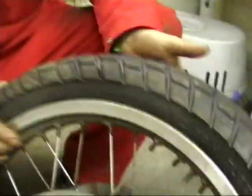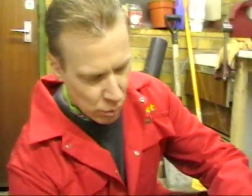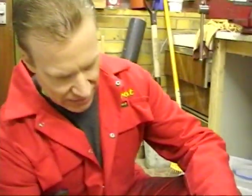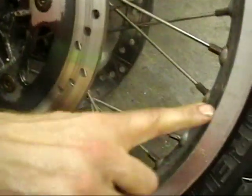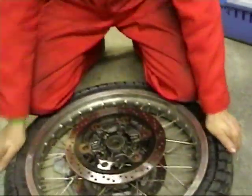The problem we've got is getting the tire off so we can work on the wheel. Trent was explaining to me the breaking of the bead. Obviously in tire shops they have special machines to break the bead of a tire. The bead is the steel part of the tire — it's like steel wire, loads and loads of steel wire that run around the circumference of the tire. It just sits right up against this edge all the way around on the inside of the rim. If this was a motocross wheel you could just lie it on the ground, push down, and the beads would break. These are a bit more difficult — a tire shop has a special tool to push the beads off.